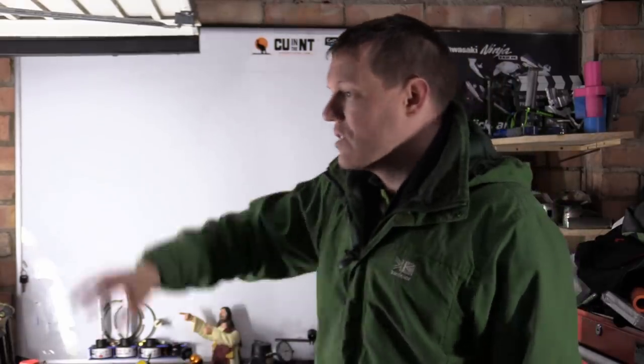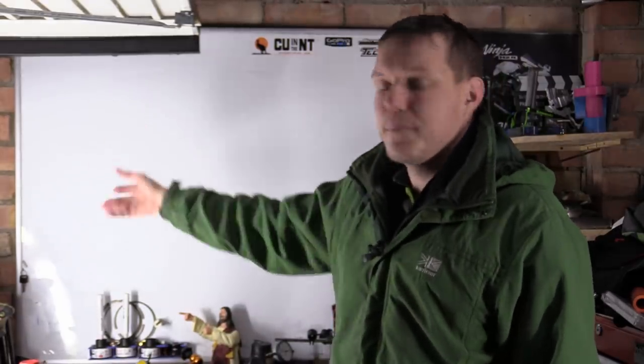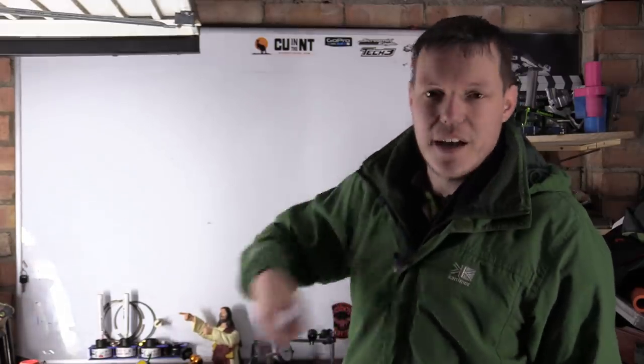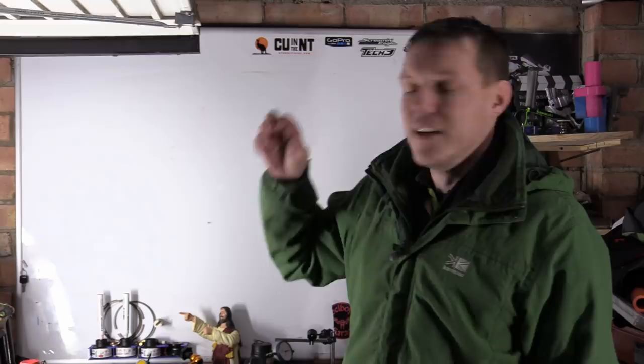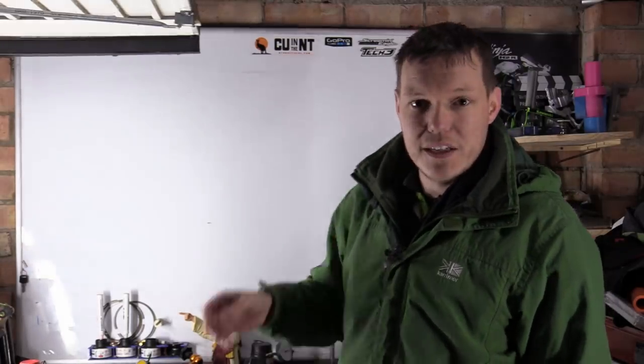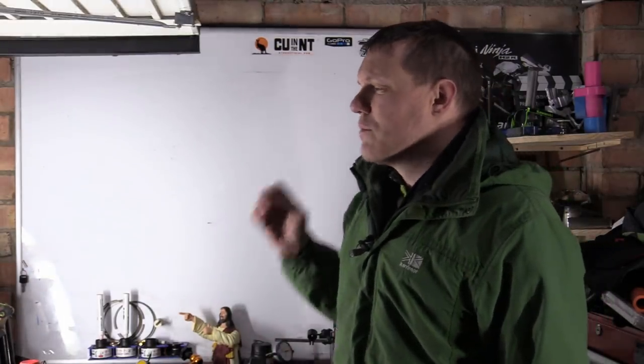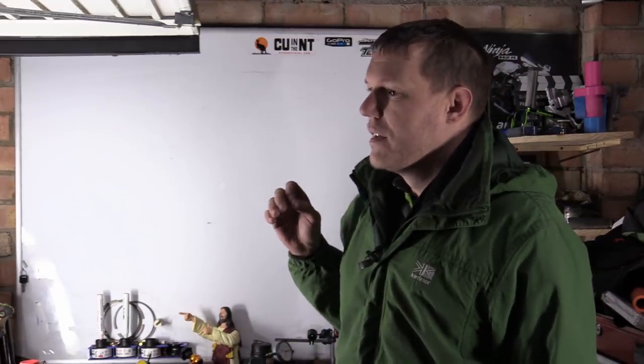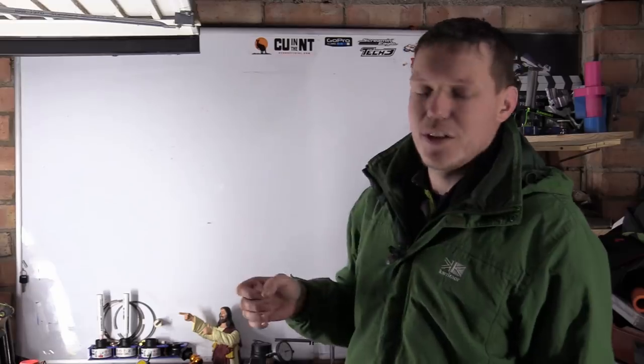And then what happens is that exhaust gas goes into your cylinder and then it pushes out, because you've basically slowed that right down, which means you've messed up all your harmonics for your exhaust and all the rest of it. And some more of that fuel makes it into your exhaust pipe. I'm trying to think of a way to demonstrate this with some slinkies, some ping pong balls and so on.